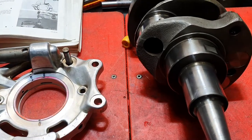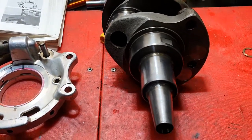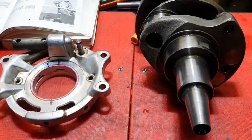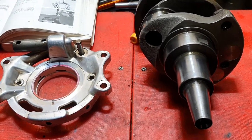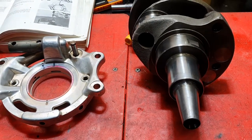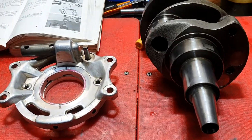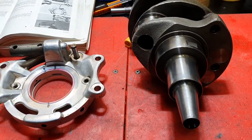That is why I shudder when people from other countries pull a bike out of a shed, put some fuel in it, and start it right up. All the crap that's in the oil after being parked for a long time settles to the bottom of the sump. You start it up and the oil pickup just sucks it straight up and throws it through the engine. The filter might or might not be alright after ten years standing in a shed, but I wouldn't want to chance it.